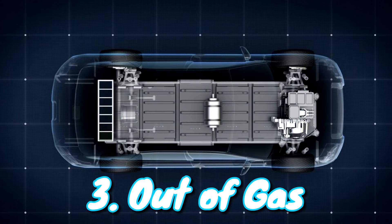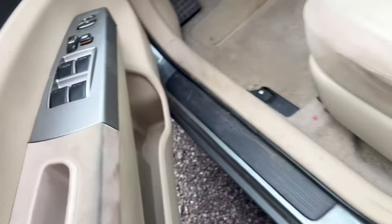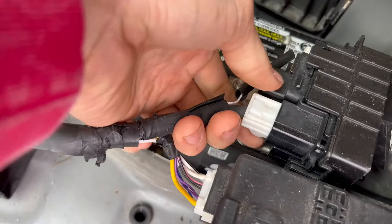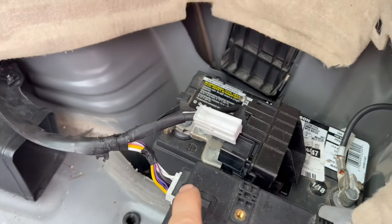The third thing is your car could be out of gas. Hybrids tend to act a little different when they run out of gas. This seems like a pretty simple step but it stumps a lot of people, because hybrids do act a lot different when you run one out of gas. Once you put gas in, you're going to want to disconnect the battery — this helps reset the computers and get everything back up and going. Once you have it disconnected for about a minute, plug it back in and you're ready to start it up.